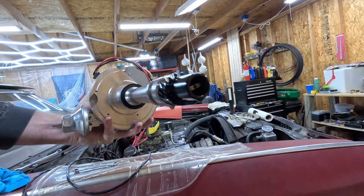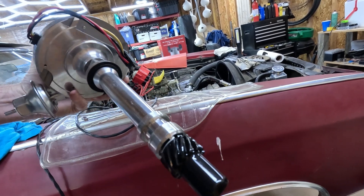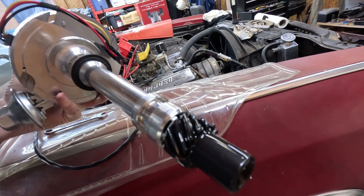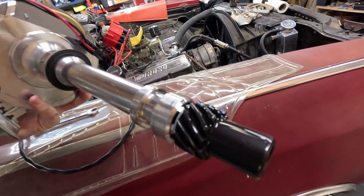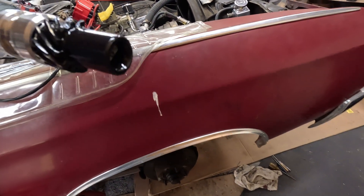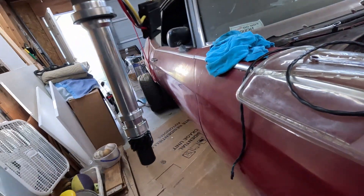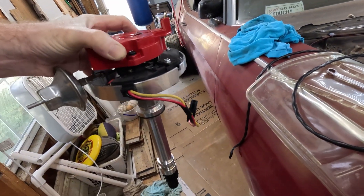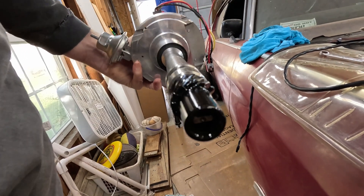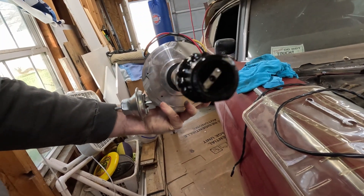You can see in there — that shaft looks like the bottom of a flathead screwdriver and it has to line up with the oil pump shaft that's in the engine. To do that, we're going to take a long flathead screwdriver, index where you need it. So if this is about right there — turn it, so about there. It's actually going to engage when it's a little lower, so I want it turned about like so.